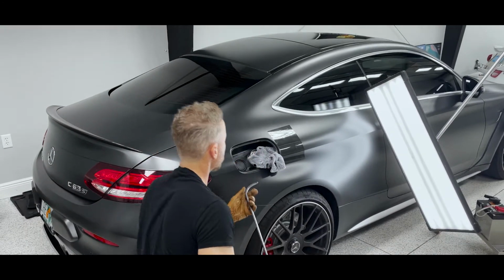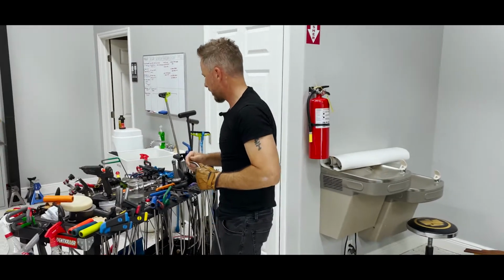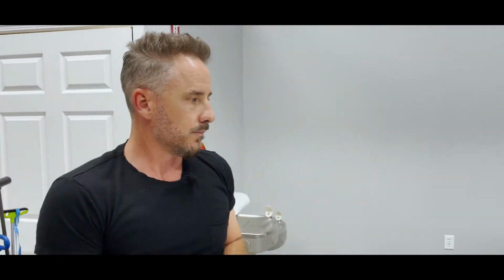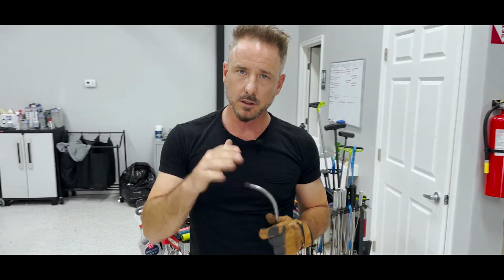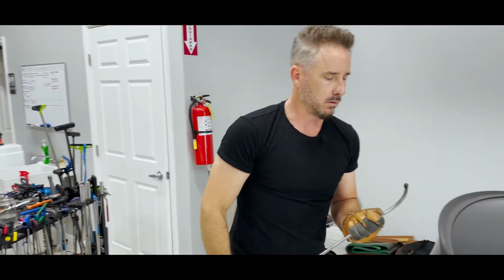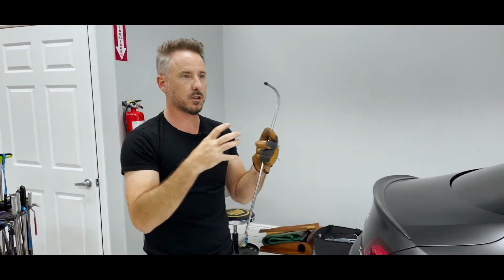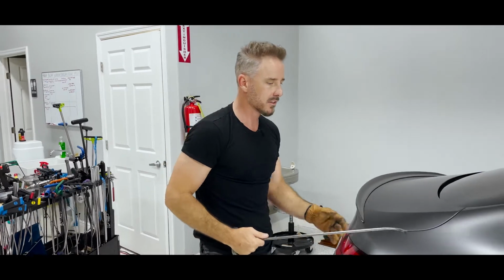Okay, so now, if I had to pick a percentage where I'm at, I would say somewhere around 80. Since I have it at 80, and I've got the bottom kind of filled, you've got to think about the dent was like this, but then right in the bottom it had another ravine. I've got that all uniformed. I'm going to go back to a little bit more of a blunt tip, rubber tip. And now I'm going to really try to work on lifting and exploding all of it in a bit more broader sense.